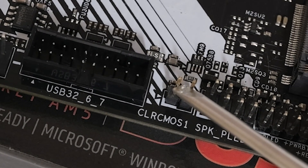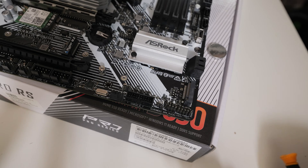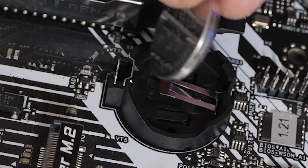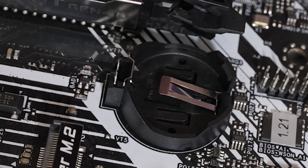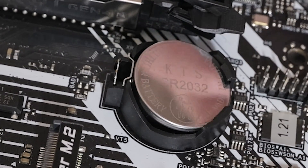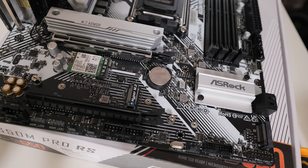When you're happy, remove your screwdriver from the Clear CMOS pins, then go ahead and reinstall your battery, observing the polarity — positive on the top. Place it in on the side away from the clasp; you'll see small plastic lugs that hold the battery in place. Then with a little firm pressure, push down on the battery and you should hear it lock into place. We've now effectively cleared our CMOS settings and reset the board back to BIOS defaults.